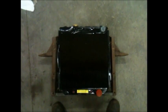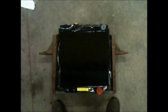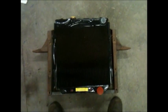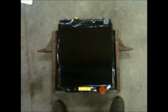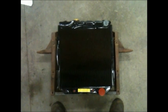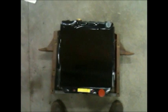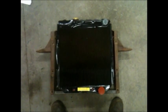Here's what I'm going to go with — it's a 1965 Mustang radiator. A lot of guys have said that it will cool just fine. This is designed for a V8, like a 289, so I'm sure it'll cool a 305 just fine. It's just a hair smaller than the original radiator that was in this. It's got a transmission cooler, as you can see.